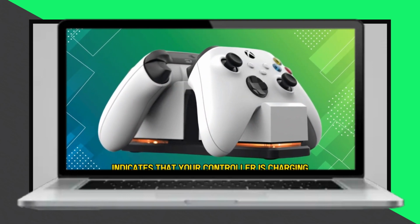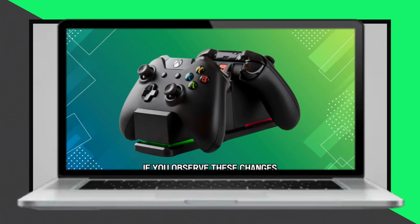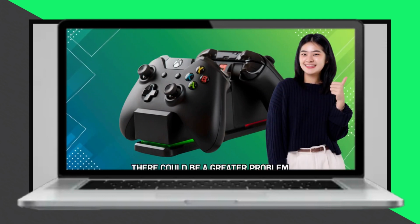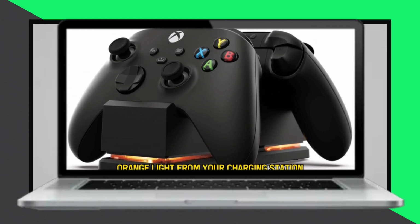Your Xbox controller blinking after changing the batteries could be caused by several factors. The following are some common causes of the blink. Firstly, your battery contacts could be pushed in too deep, or the controller isn't well connected to the Xbox. Now, let's look at the best solutions you can apply to fix the problem.